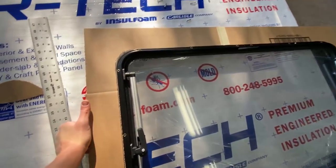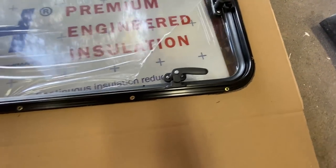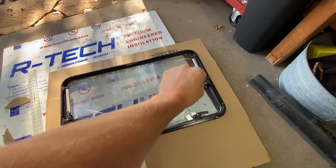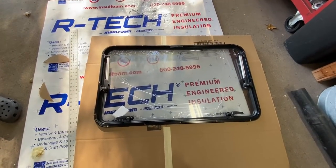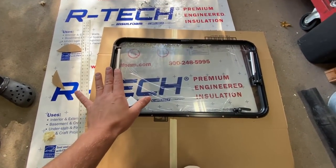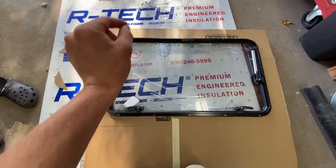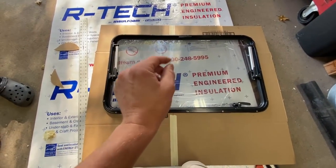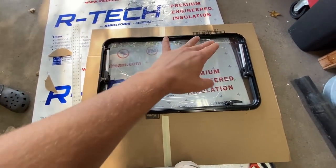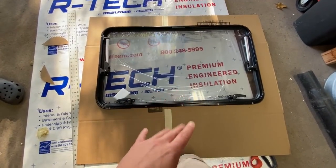We have a really tight fit on all the outer edges. Cardboard is not the best templating material — it always leaves a little shrapnel on the sides when you try to cut it perfectly. Once this is cut in sheet metal, the hole has to be just a smidgen bigger than the window itself. That's why they recommend three millimeters on the vertical and three millimeters on the horizontal. This cardboard template is ridiculously snug, so I'm just going to make sure to cut on the outside of the line with the jigsaw.